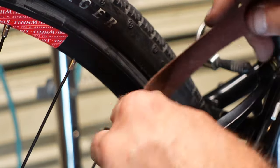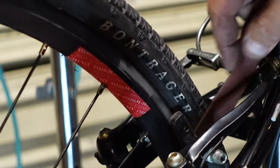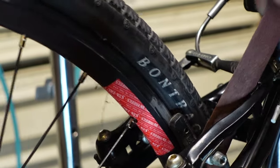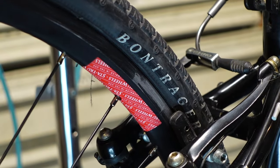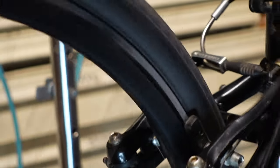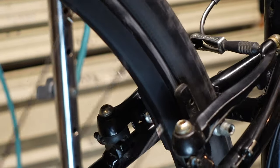So it's just emery cloth from the hardware store. And you can take it and get behind your brake pad too. That just kind of puts a new surface on things. And no more squeaking. I think this was an easy one,